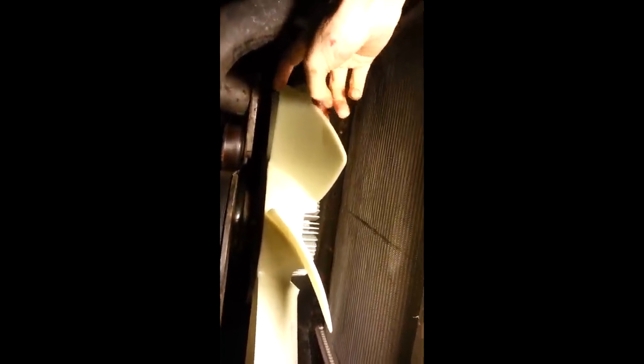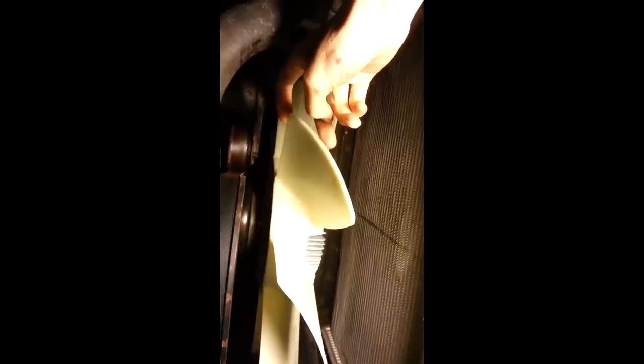One last thing: earlier in the video I showed how easy the fan blade was to turn on the old clutch. Now with the new one, this is how tight it is — it will not free-wheel at all. Now mine — I've got the same engine in my RV, and this is a buddy of mine's — with it being the original fan clutch from 2005, if I grab a hold of mine and turn it as hard as I can, it goes from 3 o'clock to 6 o'clock and then stops, so the most I can get out of mine is a quarter turn. But with his new one, I can't even get that. That's the difference in a new clutch, and I guess mine is showing a little wear. So if you're having any cooling issues with your 8.1 Vortec and the fan blade turns really freely, then you know what the problem is.